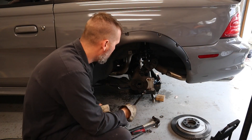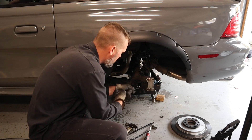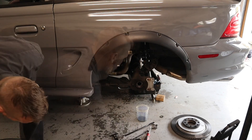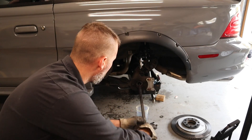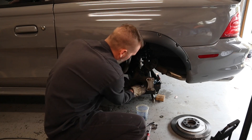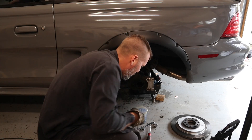While I had the differential out, it was the perfect time to pull out the seal and the bearing. I've got the tool to remove the seal, so we'll pop this out. I don't have a fancy puller, so I'm doing this while the diff is out — using a long stick through and banging it out from the other side. Also, there was a lot of metal in the fluid, so I'm trying to get the differential completely cleaned out, draining it and jacking it up on different sides to get all this nasty fluid out.